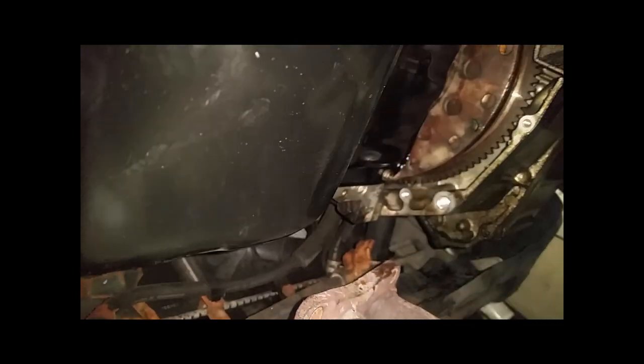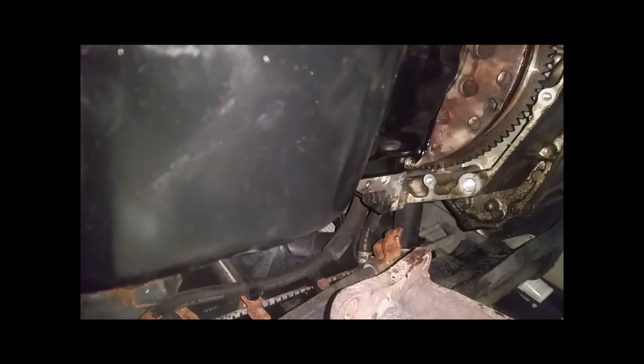I believe I need to put all the bolts and studs in first to locate the gasket. I think I did something dumb and snugged one side down already, which I knew better than to do. Shouldn't be too big a deal though.